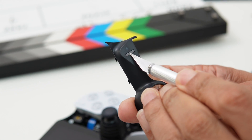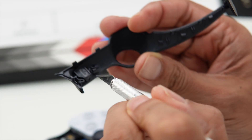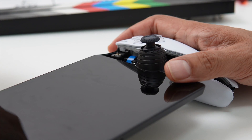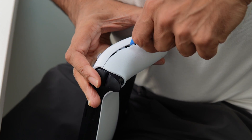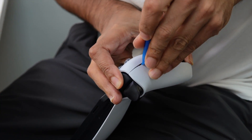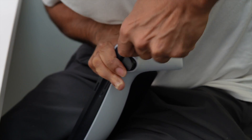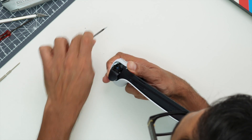On the clips we can see we've got a switch on either side, using separate parts and a living hinge which is ultrasonically welded in place. Now we're going to open up the exposed screws on both sides. There's also a screw on the end securing the top controller cover. Trying to remove the top controller cover — not sure if it's glued yet, so being careful not to damage the part. I realised I needed to take out the L1 and R1 trigger, which exposed more screws that were preventing me from taking the top controller covers off. Let's get those screws out.